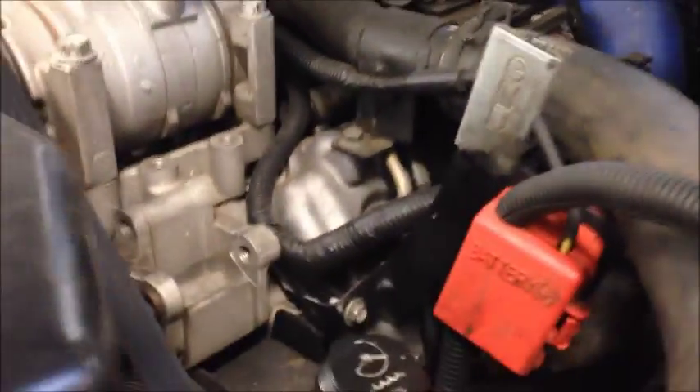Now I'm going to show you what was my problem. The heater was heating up and everything seemed good, but basically I wasn't getting anything. This is the intake air heater and glow plug controller — this is the glow plug and intake air heater control circuit. If you take this black cover off right here, that's going to be your relays for both the glow plugs and the intake air heater. This red is going to be hot all the time. This boot right here is your intake air heater, and you can also probe that with a test light to see if it comes on when conditions are met.